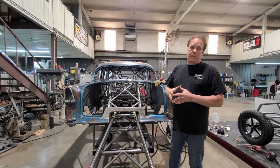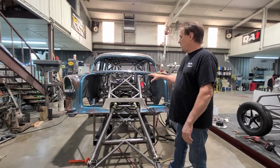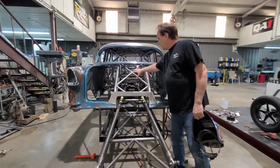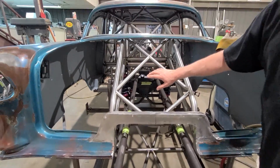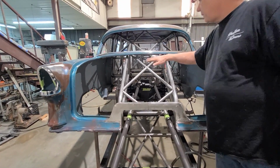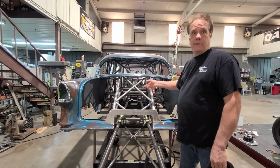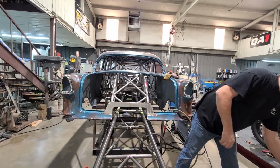That's called not thinking ahead. I thought I was, but I wasn't. I didn't consider it. So now that I've seen the wheelie bars on the car, I've cut the pan out, I'm going to take these X bars and put them down on the lower bars like they typically are on other cars. Then the gas tank is going to protrude up out of the frame, come back to where it just fits under the trunk lid, so I can get 23, 24, 25 gallons. I think I figured that I could get as much as 27 gallons in there, but